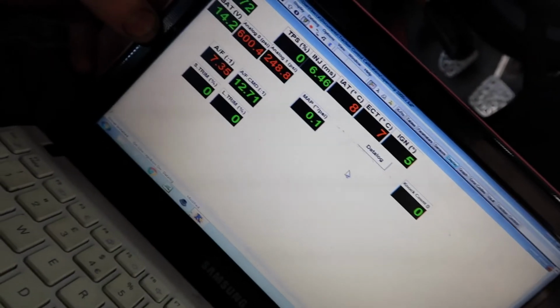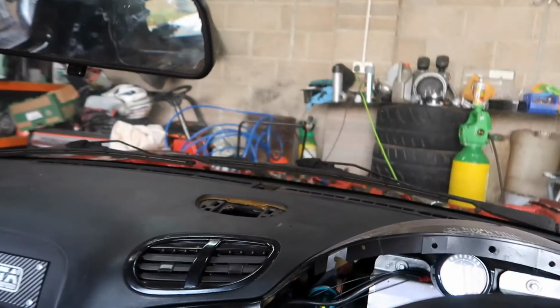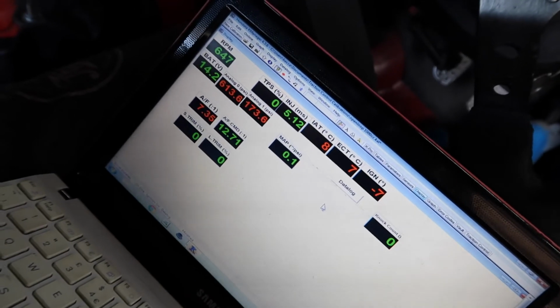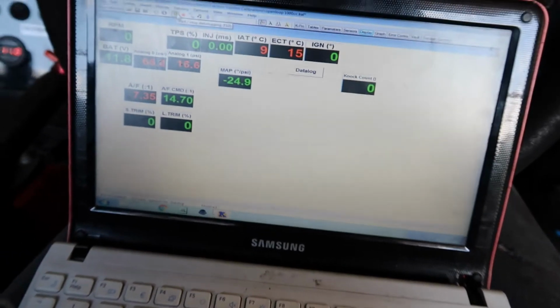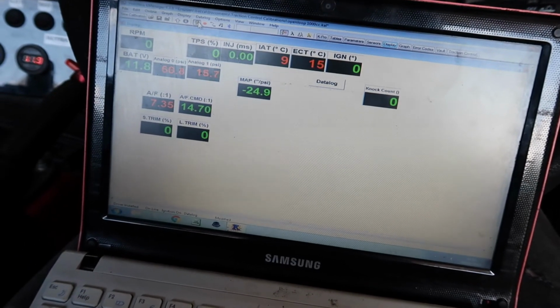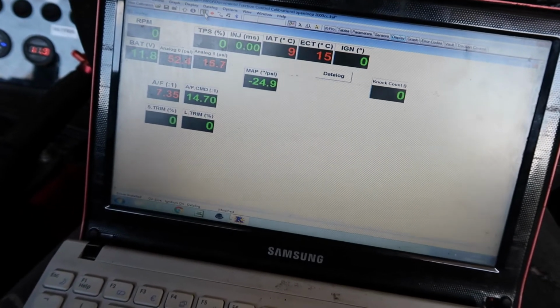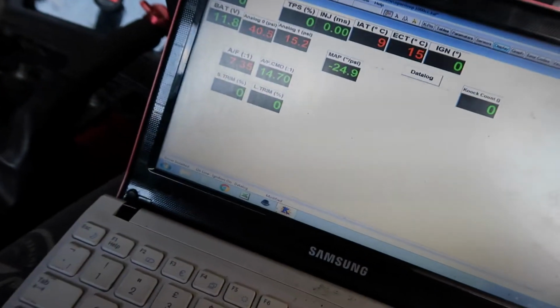Oh yes! Although that's going to be wrong because the map sensor isn't actually in the manifold, so... Oh, it takes throttle! Yeah, so I don't know how, but the K-Tuned map sensor's messed up. K-Tuned map sensor isn't working. Right. I'm going to have to swap out for the stock one that works. I'm going to have to try and sort something out.